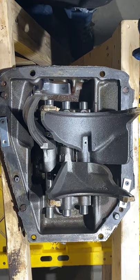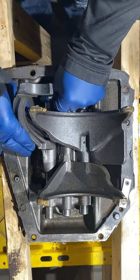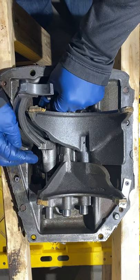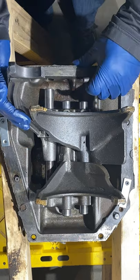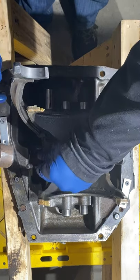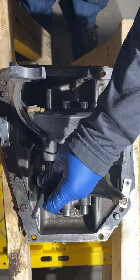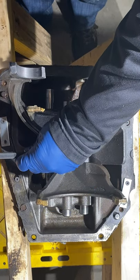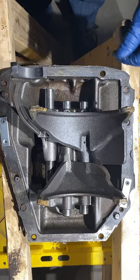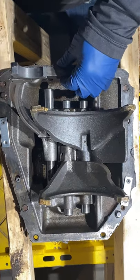Now, mind you, there is a method to the madness. This has to be back here for this rod to come out. Otherwise, if the ball bearing's getting pushed over and there's one in one of the grooves in this rod, which has a pin in it, it won't be able to come out. So you've got to make sure this is all the way back here. Tray underneath, everything drops out of the shift hole, drops down on the tray. There she goes. You fight all day if you don't have this reverse gear where it needs to be. Forget about it.